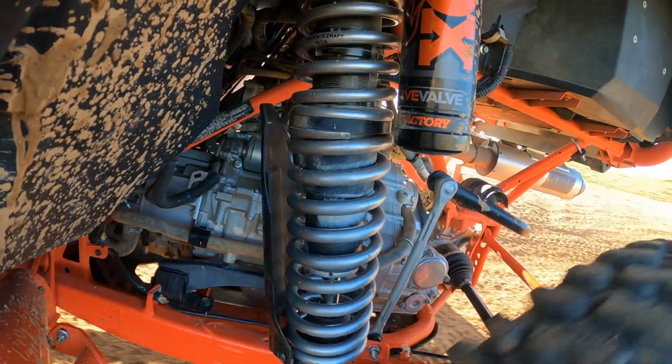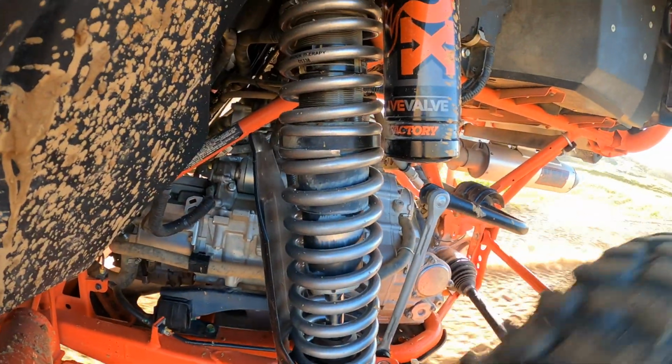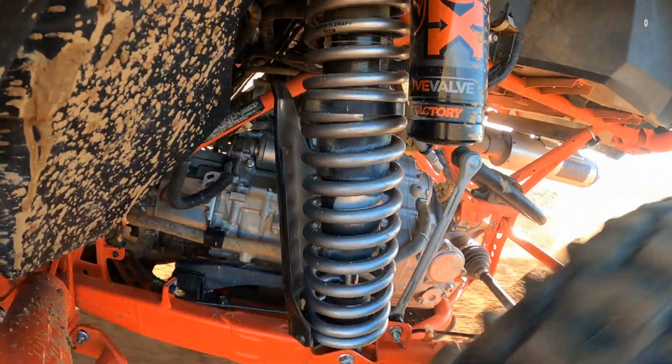We're talking about ride height, and we're going to go over my first impressions after installing the shock therapy springs. I don't have a spring compression tool, so I had Cal Custom Trailers put them on for me. And it's not just throw the springs on and you're good to go. You need to check your ride height, and there's a right and a wrong way to do it. You're also going to have to adjust it after the first 100 to 200 miles. It's going to sag a little bit, and then Shock Therapy guarantees that it won't sag after that. So it's not just throw them on and hit the road.